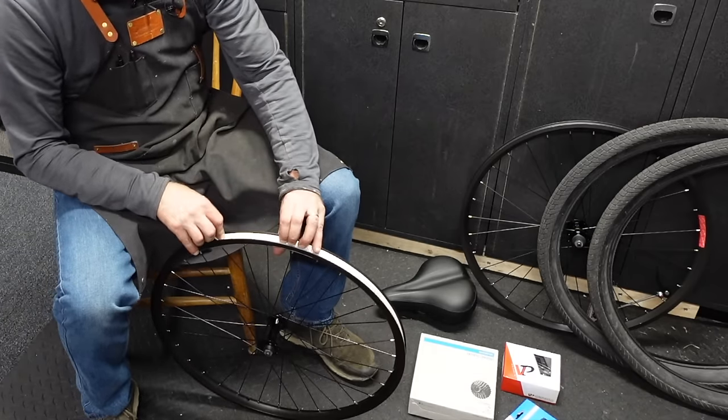So I got this piece of housing that doesn't look like it's gonna be long enough. So I'm gonna cut one a little bit longer and start there. Put a little bit of Tri-Flow. Got a handful of bits. Get the ferrule. I'm only gonna do a ferrule on one side because the noodle will handle the other side. Wire that inside those other two cables. Oh, actually, it does want a ferrule on the other end too. So some noodles allow room for a ferrule and some don't.